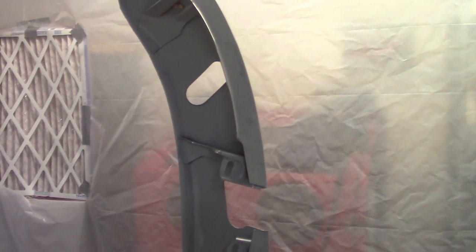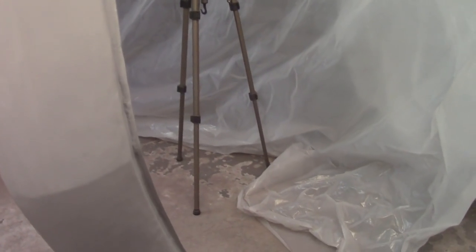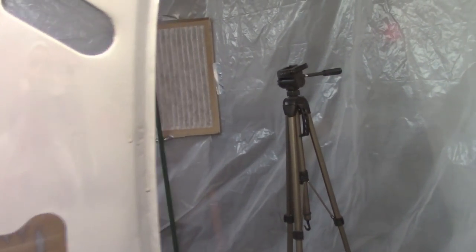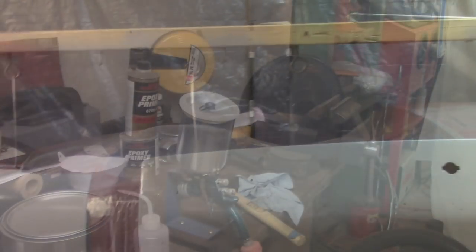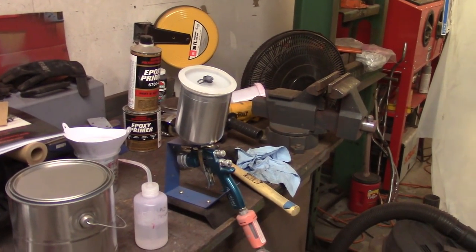A little bit too much paint right there as well, but that sanded out pretty good for me so far, so hopefully it'll be the same. The valance kept spinning on me — I need to come up with a better way to secure that. There are a bunch of runs on it just because it kept moving, but I'm getting it covered, and that was kind of a goal here — to get it out of bare metal and into epoxy to stop any further rust.